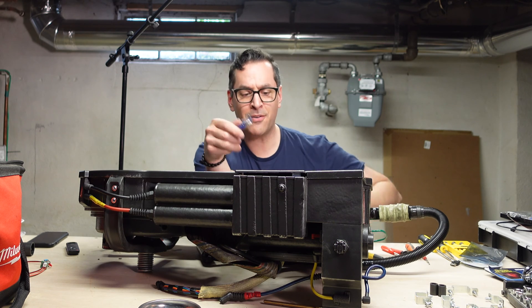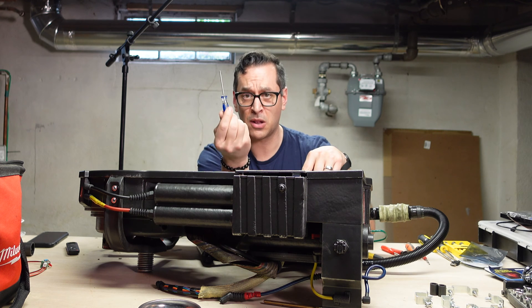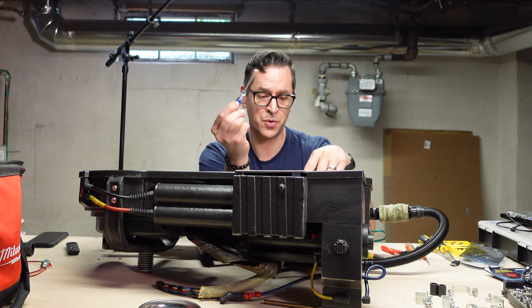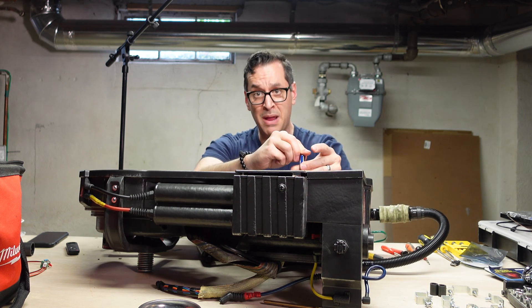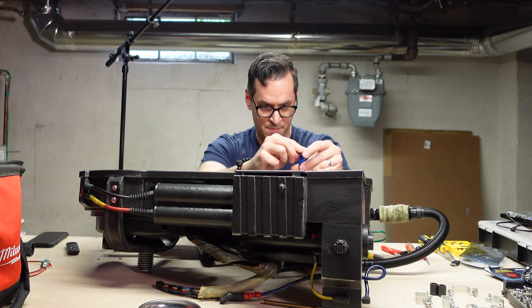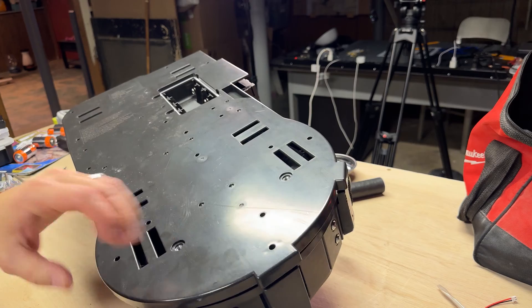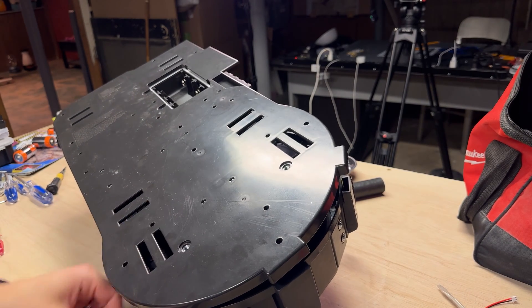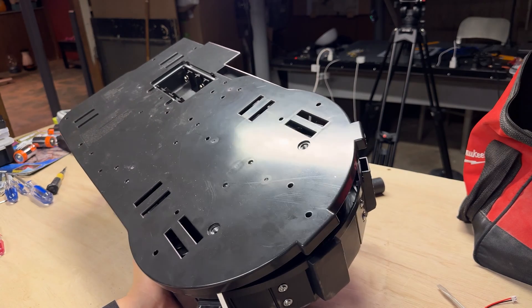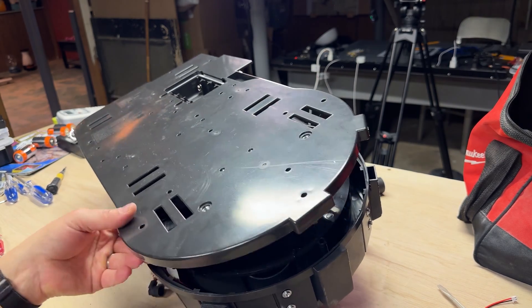You're going to need for this one last little hole a very thin and long Phillips head screwdriver. It just goes right in. Once that's out of the way, carefully pry off the motherboard. There are some pressure-fit pegs and weird angles in here, so just go slow. I pushed the cyclotron bolt up from the bottom as well, which seemed to help.